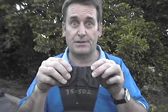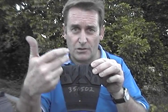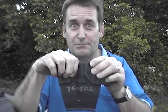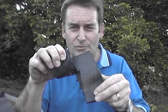And this is the Armortec 3. Remember about the cover ply? All other brands, the plies run all the same direction, and the Cooper cover ply runs at an 8-degree angle, which means that as it tears, it should butt up against that ply and make it a lot harder to tear. So this one's had a nick in the top, it's been pulled apart again. Look what's happened. It didn't run down between the cords, it almost ripped them apart.